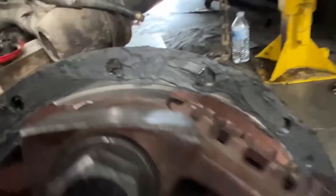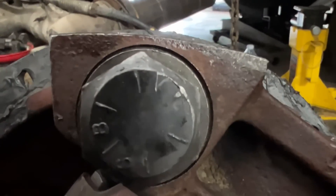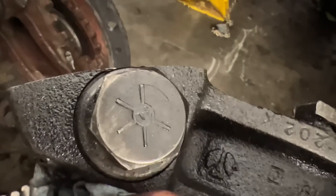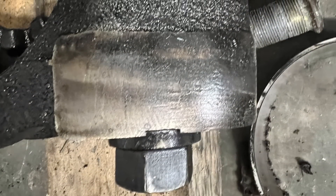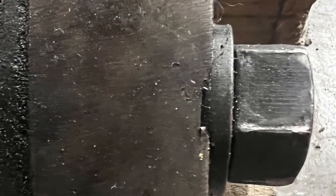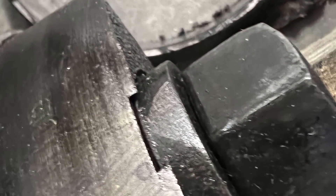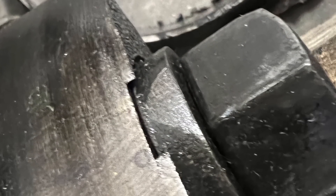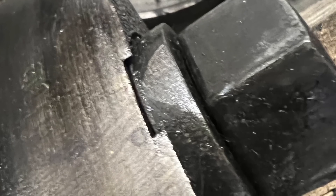You can tell even by looking at the bolt holes there. At the washers, this is much further out to the outside — this one's so much beefier. The distance between the edge and the washer compared to this one is like non-existent. So it's just machined differently. After looking at these, they're actually not machined — somebody's taken a grinder to these and really ground them way back, tapered this thing, even through the holes where the washers were. Even the washer itself has been ground down. So it's had major modifications. That's just never going to work — we've got to start over.